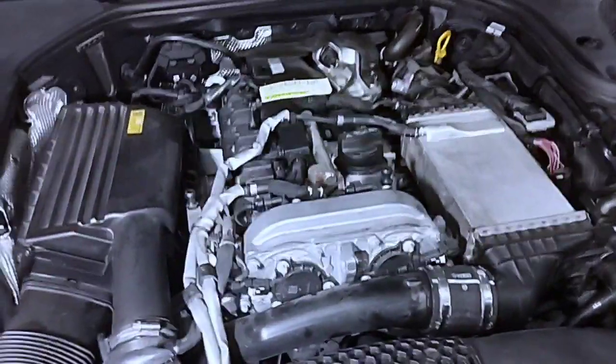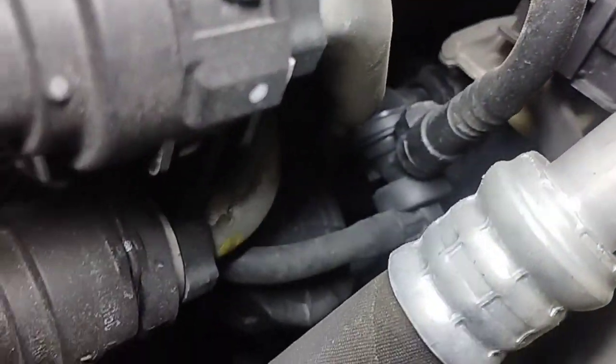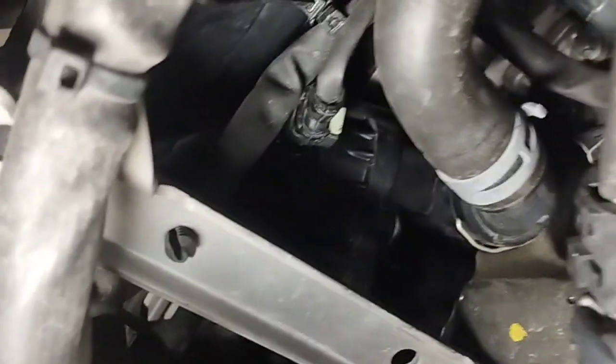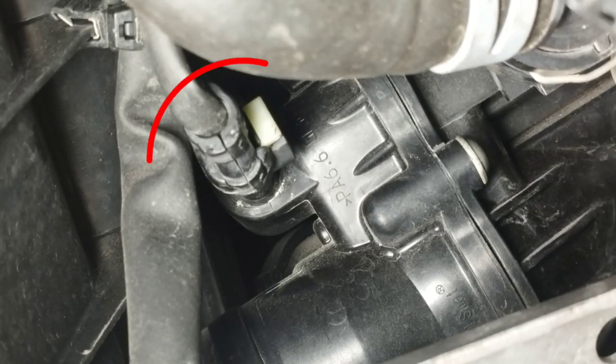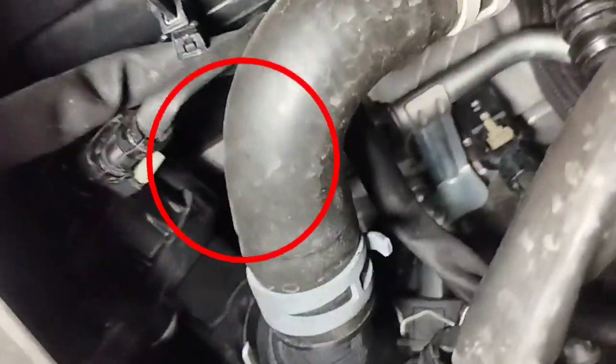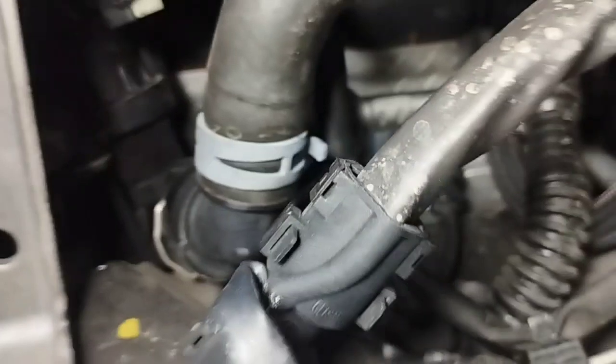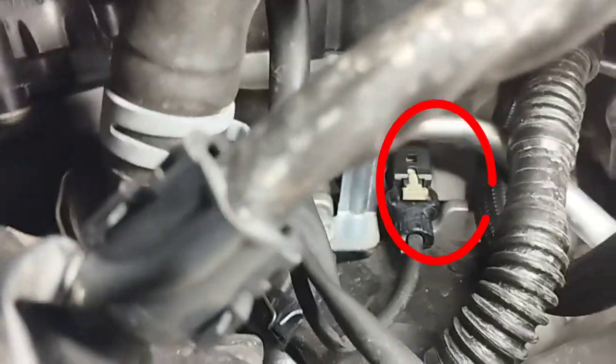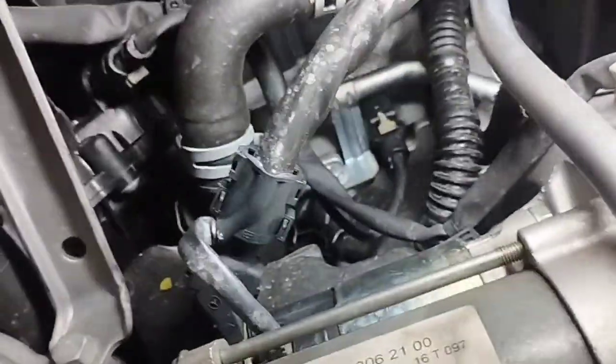The main reason is that the coolant temperature sensor is not working properly, triggering engine code P0217 — coolant temperature engine too high. I will first change the coolant temperature sensor to see if that fixes the problem. Since the temperature sensor is not visible from the top, I remove the covers under the vehicle. The coolant temperature sensor is located in the coolant thermostat housing, and the housing set must also be changed. The sensor is located in the engine block just above the coolant thermostat housing.